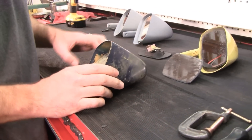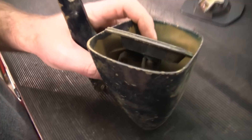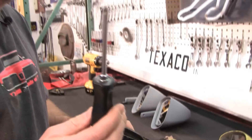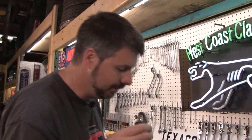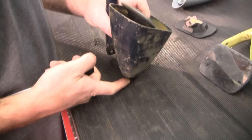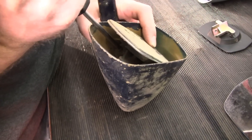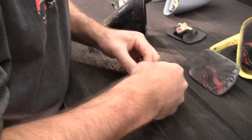Your first order of operation is to get that Phillips screw out. Some penetrating oil is good if you've got an East Coast car. Even on some West Coast cars, that screw can get really hard to get out. You've got one chance — you round out that screw, how are you going to get it out? Get a good quality screwdriver, put the tip of the head here on something firm and really give it the juice, just lean into it. This one was a little easier than some. There's your assembly.